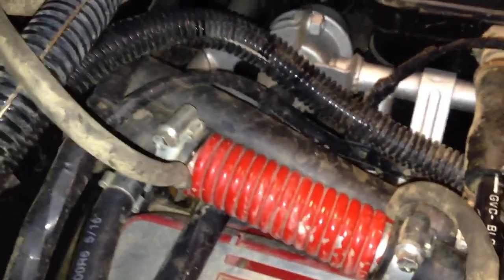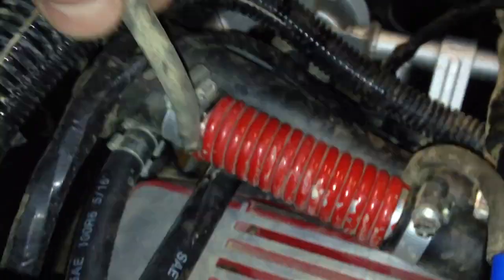There's a washer fluid heater on this car — a heat exchanger on the heater hoses from the back of the water pump. They travel along here, down the back of the bulkhead. You can see those little aluminium fittings down there — they go through to the heater. It's basically a nice little heat exchanger. This pipe here comes from the washer pump over there, through the heat exchanger, warms it up, and then out the other side.